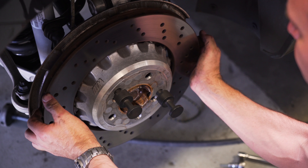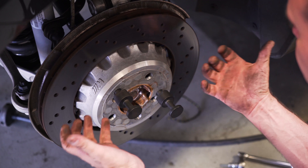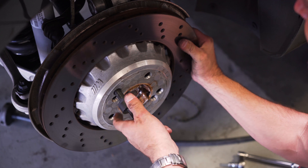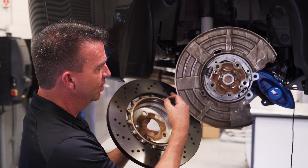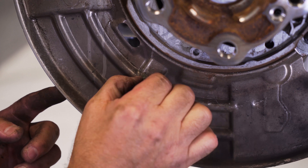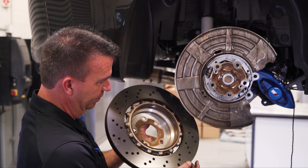So this is what's happening. As you're driving along and the front tires are turning from side to side, the debris off the road surface — little rocks, etc. — are getting picked up by the front tires. They're slung underneath the vehicle and as you turn, the debris goes everywhere. Sometimes a little rock will enter into the hole in the backing plate and get stuck between the brake rotor and the backing plate. That's what's making this horrendous noise.